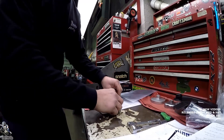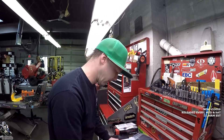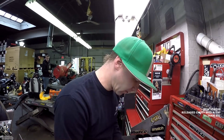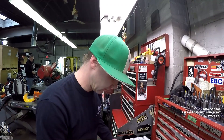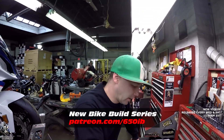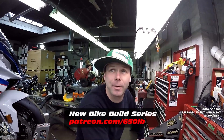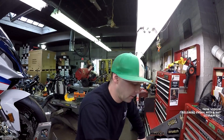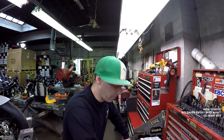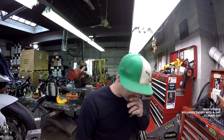So how many miles do these bikes usually come with from the factory? Most times it actually says zero — I think they reset the dashes. But I know they all run them on a dynamic dyno at the factory. Sometimes it says one or two miles; that's the highest I've ever seen. We used to have to put 15 to 20 miles on them, but they dropped that to 10, so it's now around eight miles. We try to put eight or ten on them just to make sure everything's working. There have been issues in the past where something was assembled wrong at the factory and broke five miles down the road. It's a lot better if it breaks on us and we have time to fix it than on the customer.